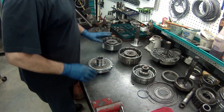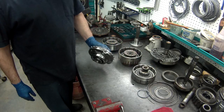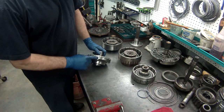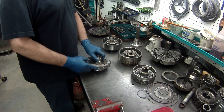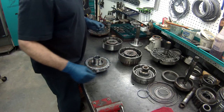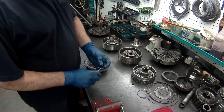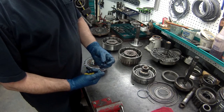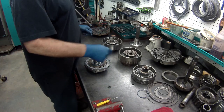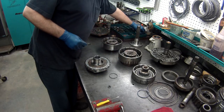Now, all right, now we got our pistons installed. We are going to start stacking our clutches. We'll stack clutches inside the drum piston, but we want to put the sealing rings on here. And there is a seal for the cooler line that goes in right here, and there is the seal second. Make sure before you install these like this, you don't lose an O-ring. Try to look for it, can't find it because it's stuck in that, and you've already got it installed. And then there'll be 4 of these.